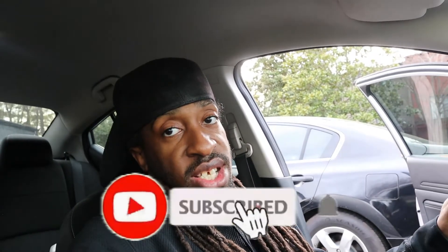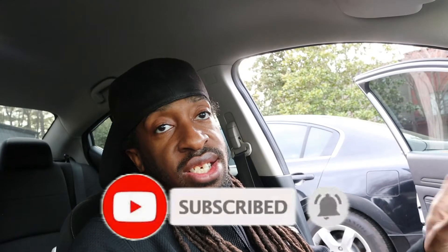What's good y'all, welcome back to another video. We're going to do these signal lights and get straight to the point. We got hyperflash on the signal lights - that happened when I put the LED lights in. Check out the last video. I'm going to go ahead and show y'all what it's doing, and put these resistors on. I already put it on one of them.